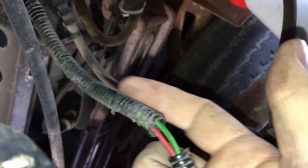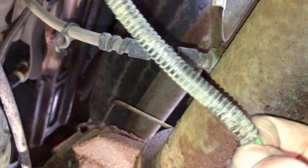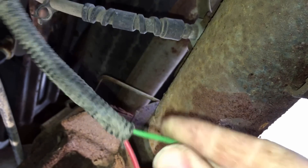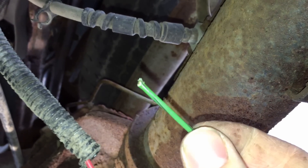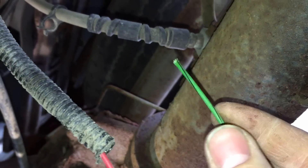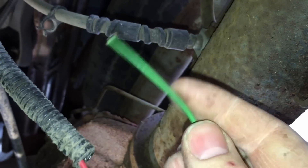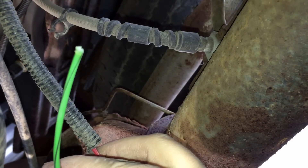Another good check I've learned over the years: once the wires are exposed like this, there could be hidden corrosion or damage inside on either side. What I do is give them a good tug — these wires are really strong, so don't worry about damaging anything. I pull on one and it's fine, but I pull on the other one and look at that — it broke off. I've seen clean breaks like this with no corrosion, basically from flexing over the years. The whole harness moves with the axle back here, so it's something to check before just changing the sensor.